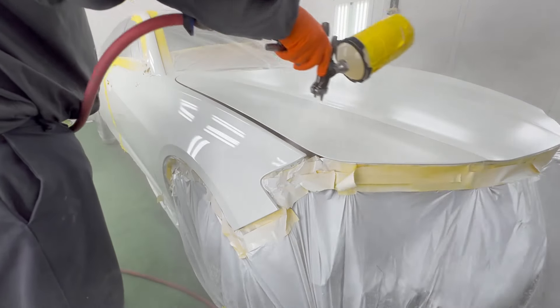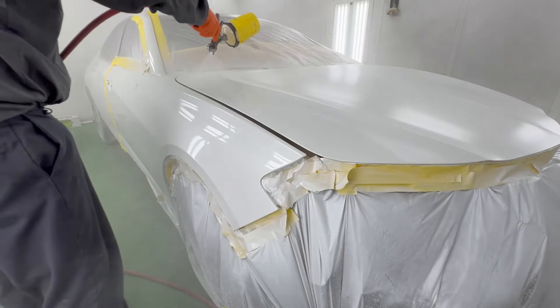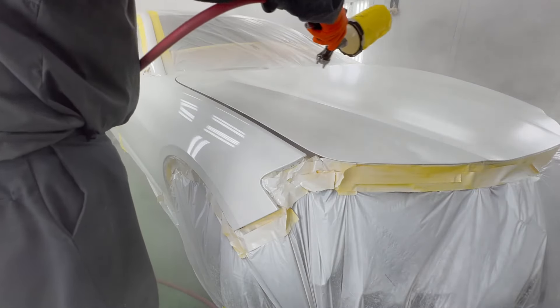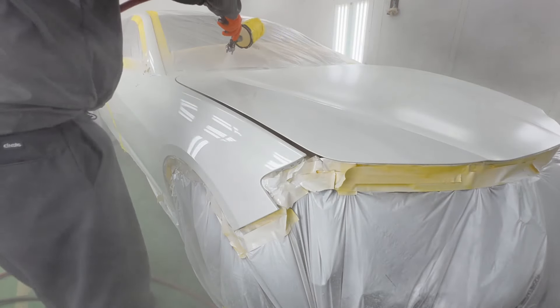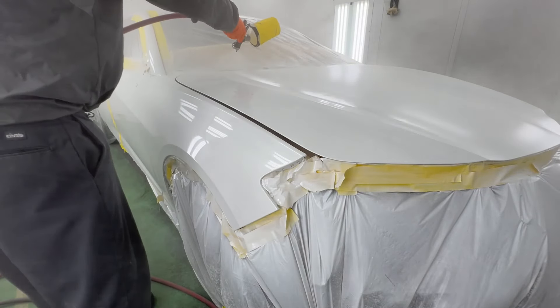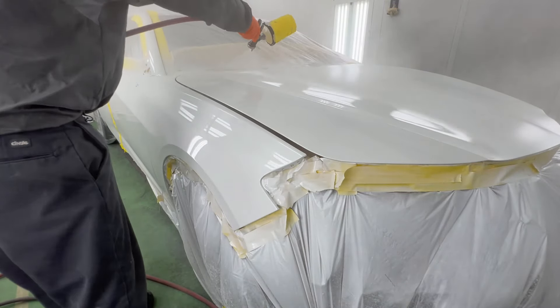Here I'm looking at my paint job and I'm looking at that tape just sticking out and flapping away — that wasn't taped down. That's a mistake. The tape is acting a little bit crappy in the humid Florida temperature. I'm thinking maybe I'm going to change over to green tape. I've been having some problems with the 3M yellow and it's just not sticking sometimes, and it's driving me insane.